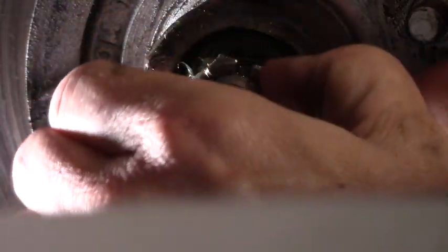You want to bend the cotter pin back together so that it's nice and straight. Bend it back into straight position. And it's usually a good idea to get a fresh cotter pin, because after that metal's fatigued a few times, you don't really want to rely on it. There we go. Got the cotter pin. Now this castle nut should be finger tight anyway, which it is. So you can just remove that. Okay.